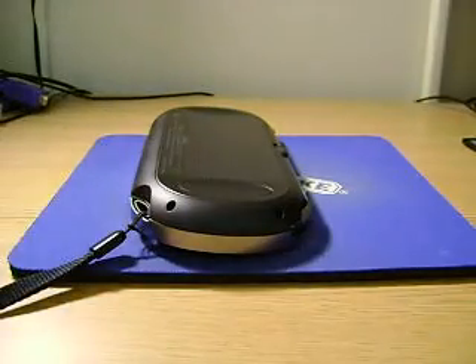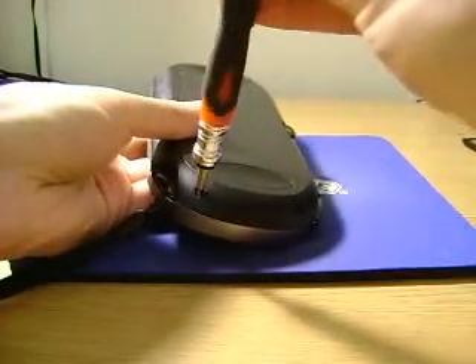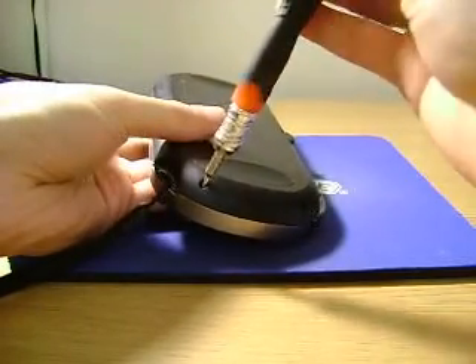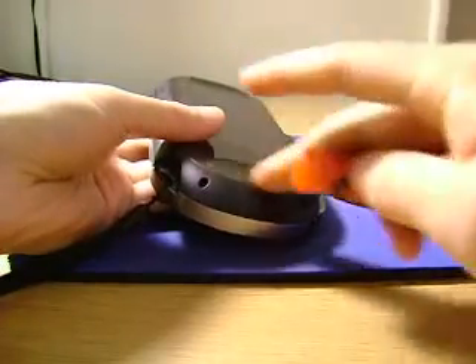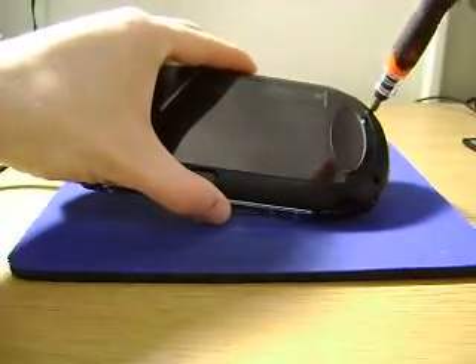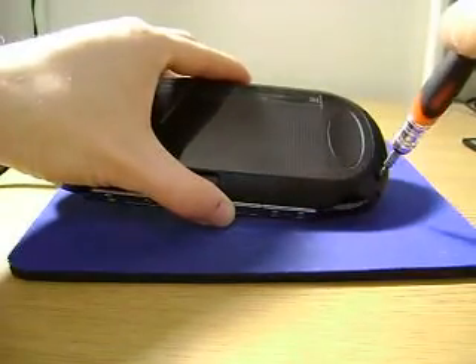I'm a little surprised — normally they don't put Phillips on new electronics. I know Sony usually is a bit difficult, putting stickers all over everything. But this is one of the few devices in their gaming line where there's no warranty stickers and no special screws required to open it. There are just four screws on the back, and as I'll show you, there are some clasps you just need to get under with a pry tool. You did something right, Sony. Finally.